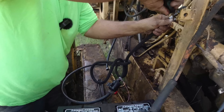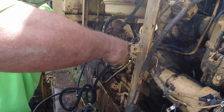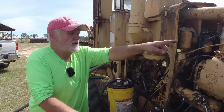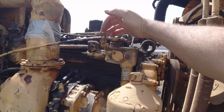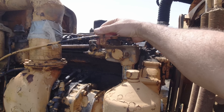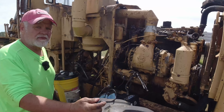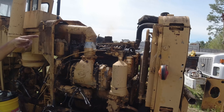What Wiley's doing is putting an electric fuel pump on it so we'll have fresh fuel and bypass the original pump. We'll see if we can get by without filters. Let's go find some fuel. See if you can turn that — that's the kill switch. Come to me. Okay, good. That's the shutoff — it's off that way. All right, it's ready to go. Moment of truth, let's see it.